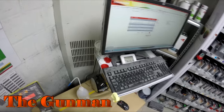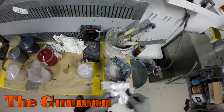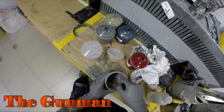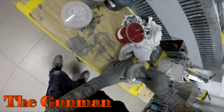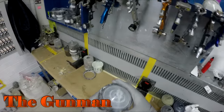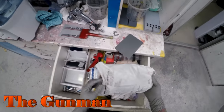You might think a 10 to 1 ratio means 100 grams of primer and 10 grams of hardener, but that's not the case — mixing ratios are always by volume, not by weight. 100 mils of primer doesn't necessarily weigh 100 grams because there's a higher solid content. So make sure you get those mixing ratios right and you're best off using a mixing stick and calibrated pot rather than weighing it. For example, the wash primer on the back of the can says 39 grams of reducer to every 100 grams of primer, or 2 to 1 — but that 2 to 1 is by volume, not by weight, because they all weigh different amounts.